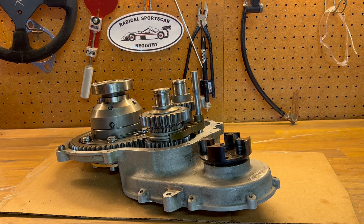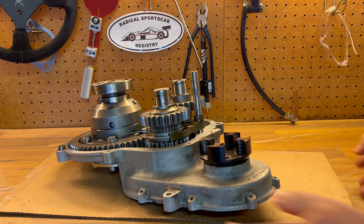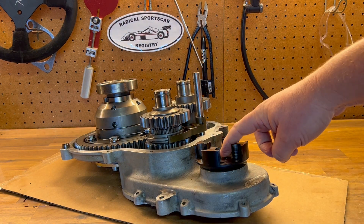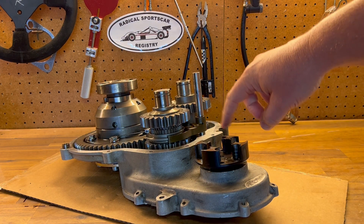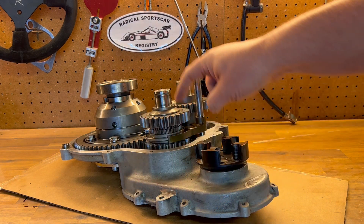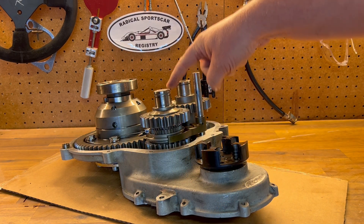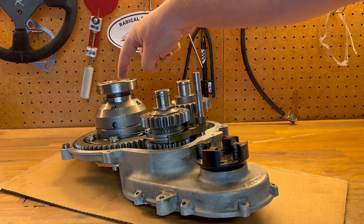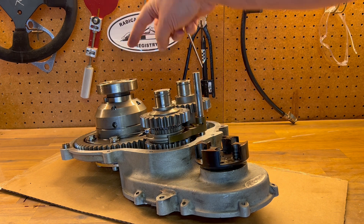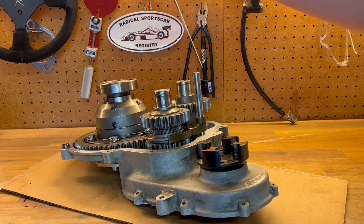This is the way the gear drive unit works. The main pieces are the input shaft, and from the input shaft the power goes through the ratio gears into the main shaft. From the main shaft it goes over to the idler shaft and then to the differential shaft. This is where the axles are — one on each side.